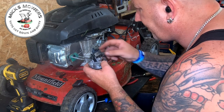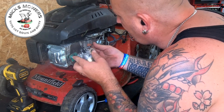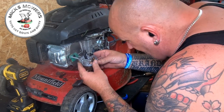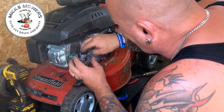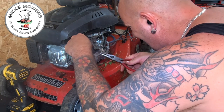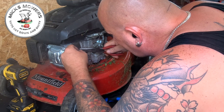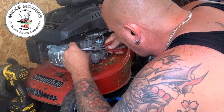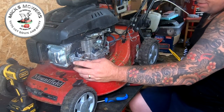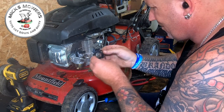Got a gasket already on there. We want to hook up the choke first, and then as we manipulate the carburettor into place you want to connect your choke up first and it will just slide in. In that goes. Then put the governor arm back on, and then the governor spring back on. At the moment everything is looking right for a replacement for the LHP16 and 19 carburettor - you can find them on eBay, just have to diagnose which is the right looking carby. Let's choke it - yeah, fully chokes, which is good, so that all works.